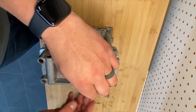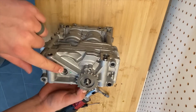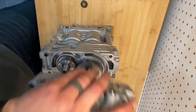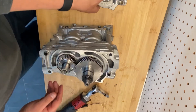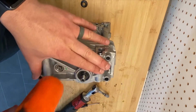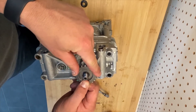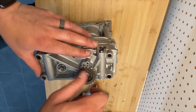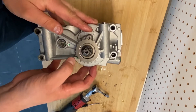I'll pull the shaft up, install your gear, and check your markings. As you can see, this is not actually lined up, so we're close but not correct — you need to go back and do it again. I just tried again, still not lined up. Hopefully that is it — I'm going to give it a little tap. Going back to do it again. Reverse thread. And as you can see, I am now lined up here and lined up there — within the marks. Perfect.